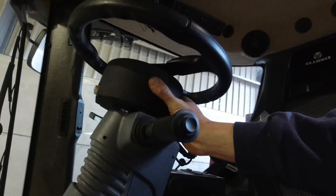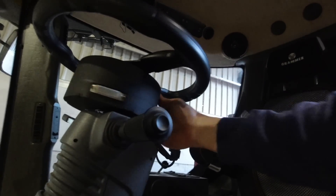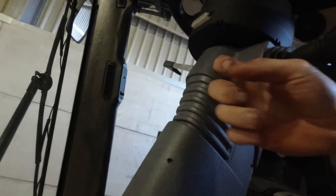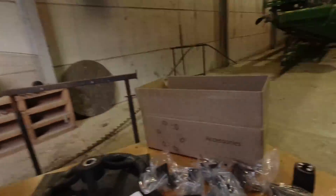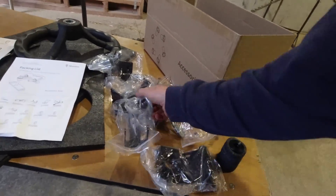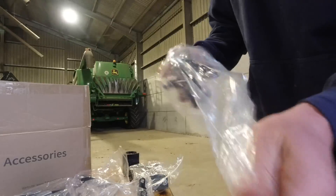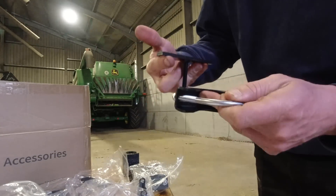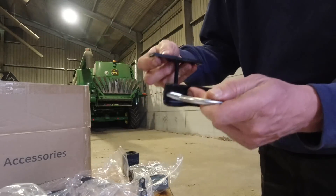This is the black unit - that's the motor that's going to turn the steering wheel. Now that needs to be fixed rigid so it can't twist, and when the motor's working it will turn the steering wheel and not lift. This could take a little bit of working out. I'm going to have to take this plastic back off again because we've got to fit one of these brackets. You get a sort of variation of different brackets - probably that one that I'm going to use. That needs to clamp to the pole and then bolt to that black unit to stop it from twisting.